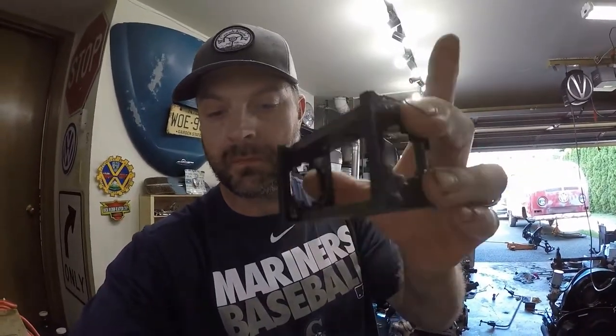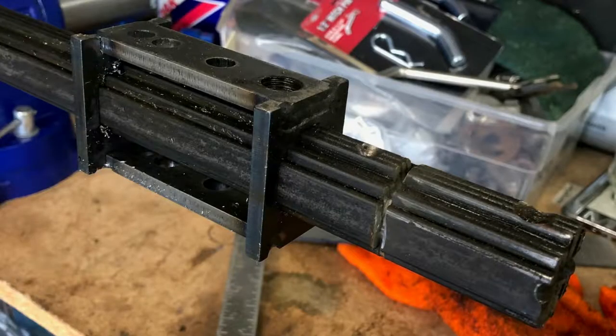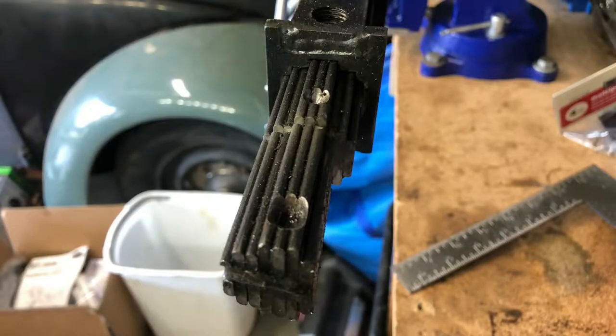So basically what had to happen is because this WagensWest beam is a 4-inch narrow beam, you have to pull the leaf springs and you have to narrow those. So WagensWest ships a kit to narrow it. It actually comes with a tool, looks like this, and it precisely lines up where the holes need to be drilled for the grub screws, and measured out to cut down to size. So very not hard, but a time-consuming piece. I don't have a drill press, so that was probably one of the bigger issues. So that took a little bit.